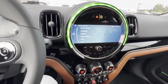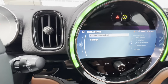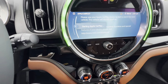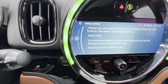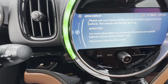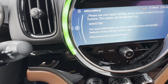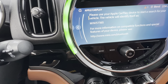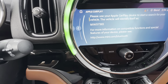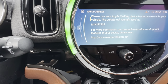Now I'm going to go to the system settings — that's where you'd set up your phone. You'd tap on mobile device, connect a new device, go down to Apple CarPlay, press on that, and then in Bluetooth on your phone it'll automatically start searching. The Mini — something like 'Mini 57365' — will come up and you'll pair your phone to the vehicle. It may say allow contacts or go to the app store — just ignore the app. The last step is activate CarPlay — it's fantastic.